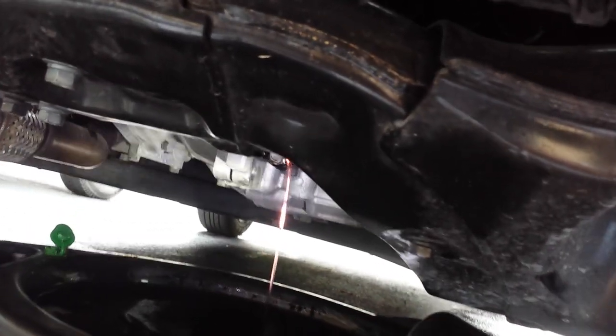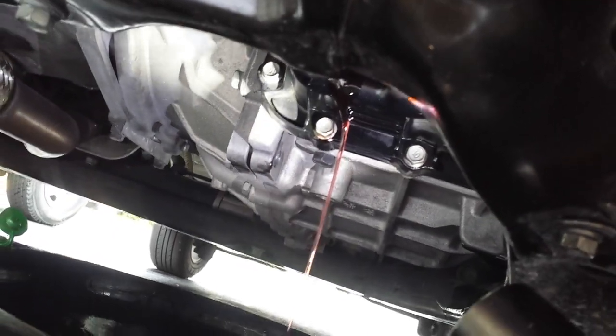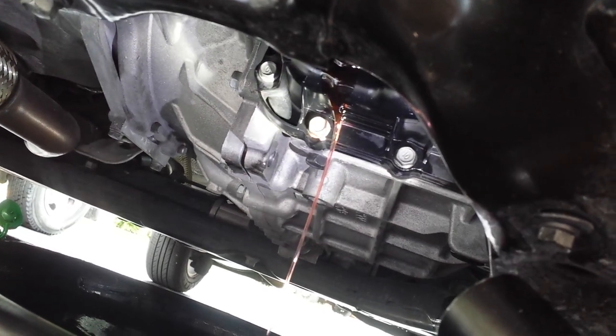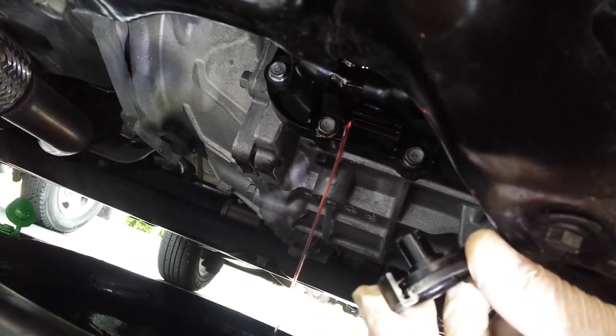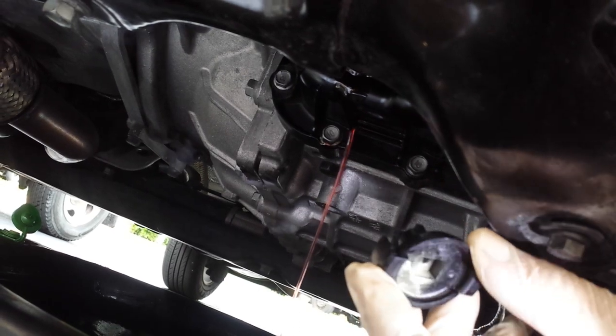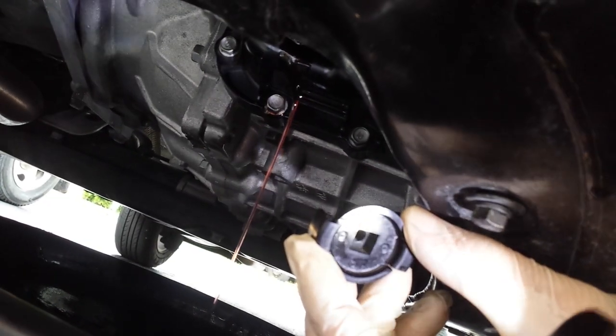As you can see, that will be the oil level. This amount is exactly what I took out — three and three-quarters, just passing three and a half. As soon as that stream slows down a little bit, I am going to put the oil leveling plug back along with my drain plug.